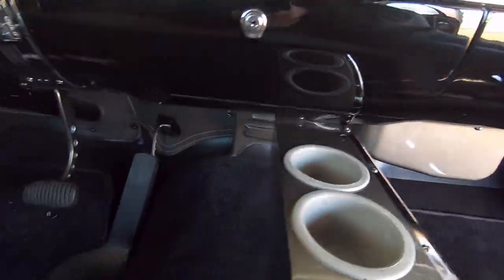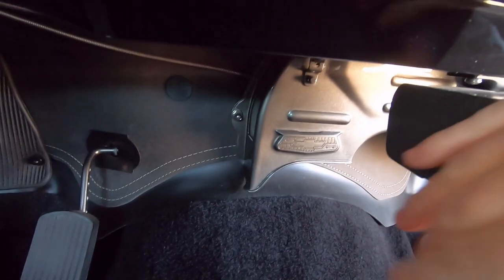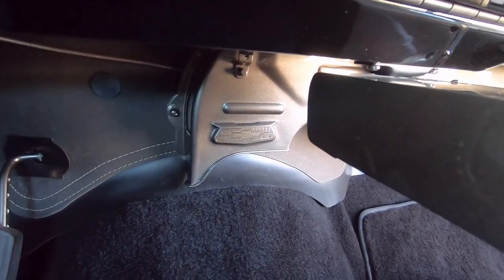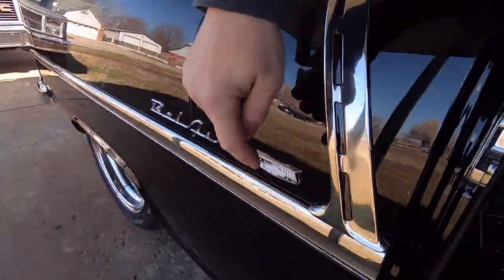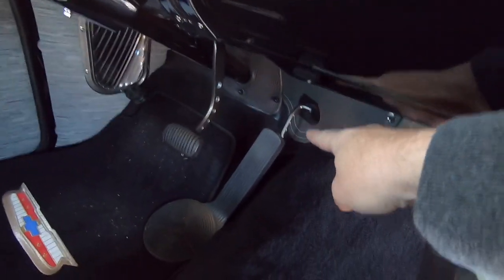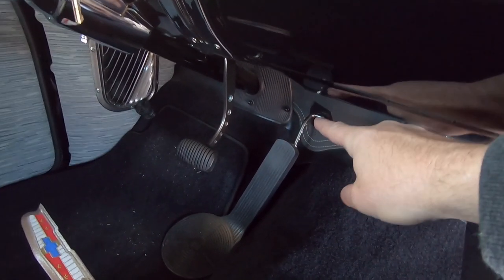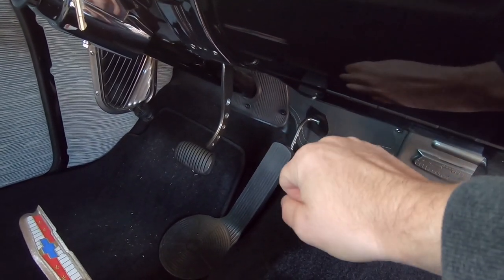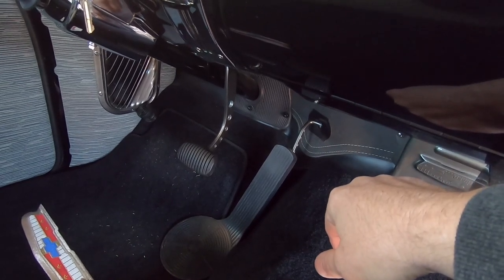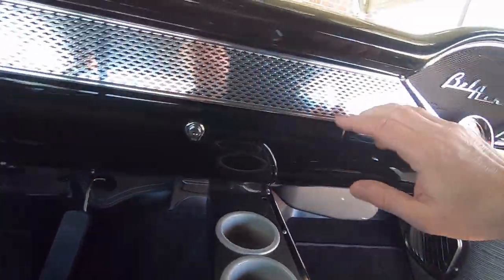The car has a deluxe factory heater box. There's a quarter panel crest panel-bonded and molded in so it looks stamped. The brake pedal and gas pedal arms are speed-holed with silver paint detail. I flattened the sides of the gas pedal, made it flat before drilling, stepped them, and welded square nuts on the flanges for the screens — so now those take 12-point ARPs as well.